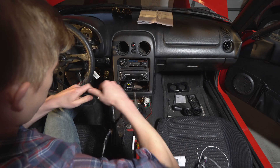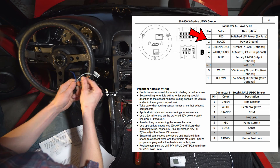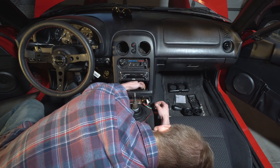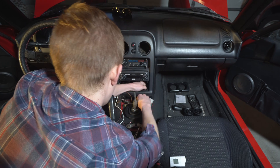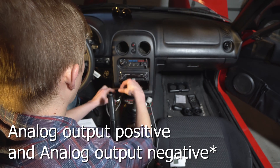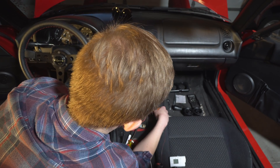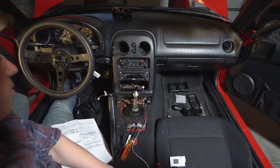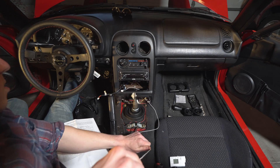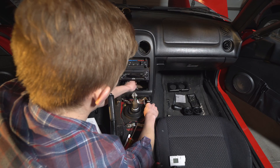Now I'm going to send power leads over here — pins 1 and 2, which are red and red with black. That'll go to our 12-volt switched and ground. Then I'm going to wire my analog signals to the Megasquirt through the cubby hole where this harness is. It's really important that you wire this analog harness with power and ground directly to the Megasquirt, because if the reference or ground is not the same between the Megasquirt and the controller, you're going to have a voltage offset that will mess up what the Megasquirt sees as your AFRs and cause it to make the wrong corrections.